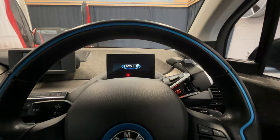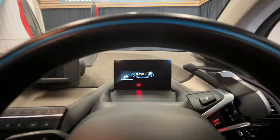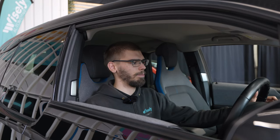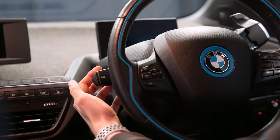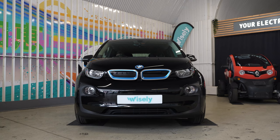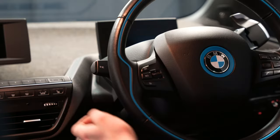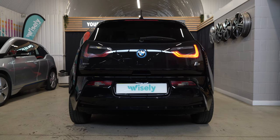For this to happen, the vehicle needs to be in the fully off state, and ironically you need to have your door open to get any notification on the instrument cluster that anything is actually happening. You press and hold the indicator stalk on the left-hand side for about a second for the front and rear lights on the left side to illuminate, and likewise push up and hold for about a second for the lights on the right side to illuminate.